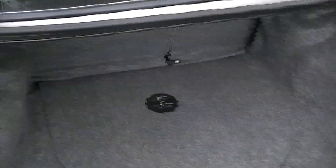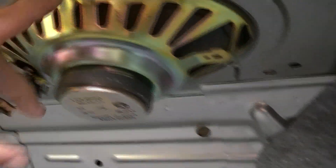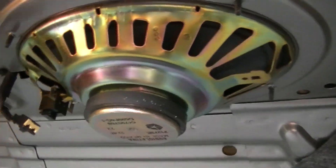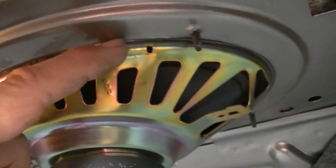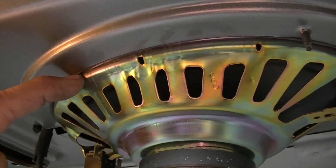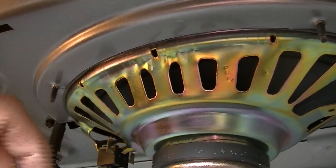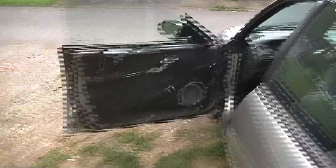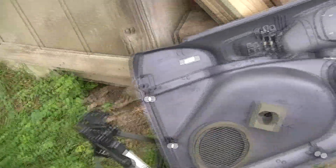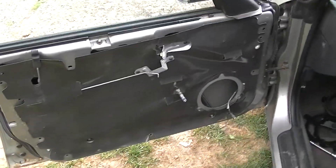Here's my trunk, it's like brand new still — the car's only just turned over 100,000 miles. And there's the back speakers — none of those work. Often when you get the back speakers put in, you've got to do them from the inside; I'll make a video on that later. Sometimes when you buy these aftermarket speakers they don't sit down in here like they should — you can see how this speaker is kind of beveled. A lot of the aftermarket speakers aren't beveled and they don't sit in here completely, so you almost have to bolt them from the bottom. But other than that, that is how you take the door panel off. Just be careful and try not to break any of your little clips there, and just reinstall in reverse order and that should take care of everything.